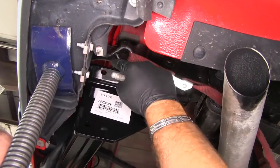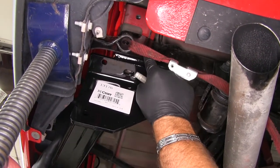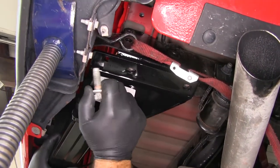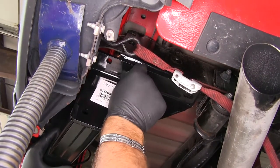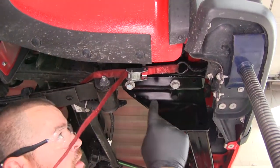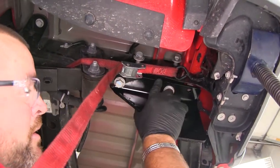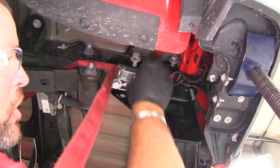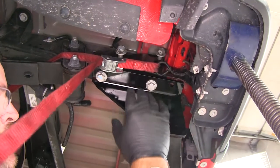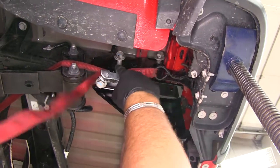You can see the bumper bracket that comes on the side of the frame rail. You want your hitch side plate to go in between your frame rail and that side plate on the bumper itself. Once the hitch is in place, line up the holes for your side bumper bracket and your hitch bracket. Use the existing hardware to hold that in place, and get them tightened down enough to hold the bumper in place. Then tighten everything down the rest of the way.